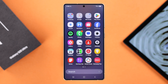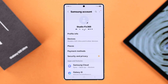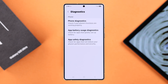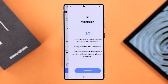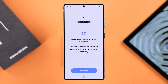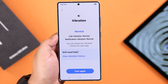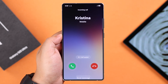If you're still having this problem every once in a while, you can test your vibration from Device Care — just make sure you're logged in with your Samsung account. From Settings, go to Device Care, scroll down to Diagnostics, then Phone Diagnostics, and find Vibration in the list. Tap on it and test the vibration by tapping the button. If you can feel the vibration press Yes, otherwise press No. Based on your diagnostic result, you can either test again or take the device to Samsung Support.